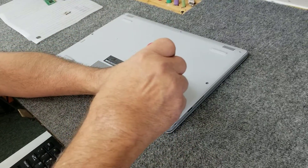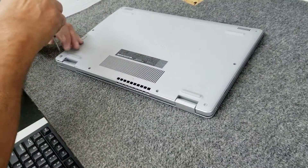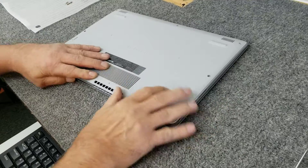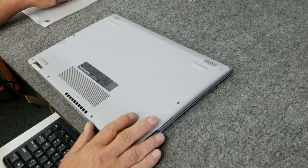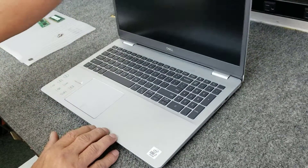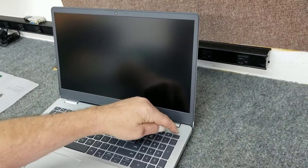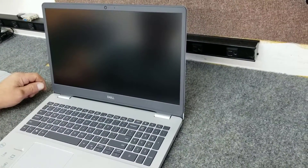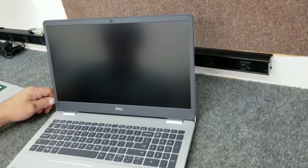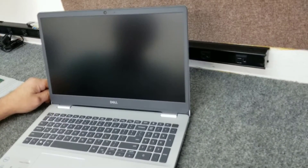I'm going to do that right now. On these Dells, when you fire it up for the first time after changing the RAM configuration, it'll take a little extra time because the BIOS is going to be reading the memory. It's going to come up and tell you there's been a change — you just have to wait for that and then click continue. All these screws are the same size; I'm going to put those back in. Once I fire it up, make sure everything's okay. The power button on this model is also a fingerprint sensor, that's why there's no markings on it. This will take a little extra time to post, so be patient. Don't forget to check out some of my other videos — give me a like and subscribe, that would be awesome.